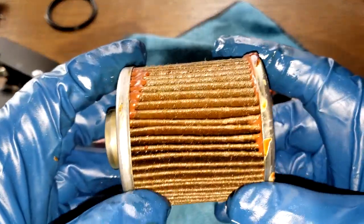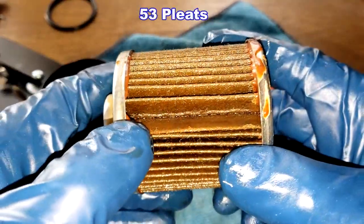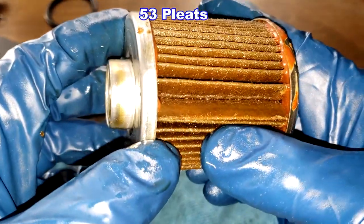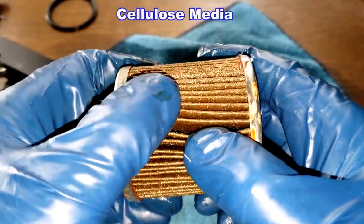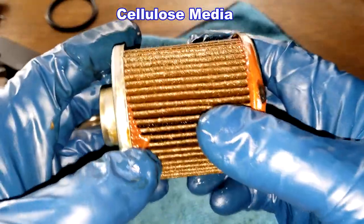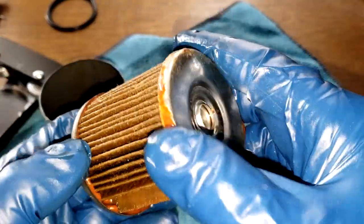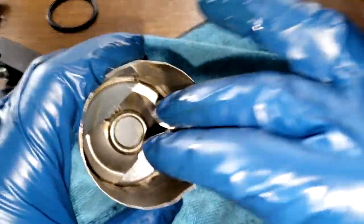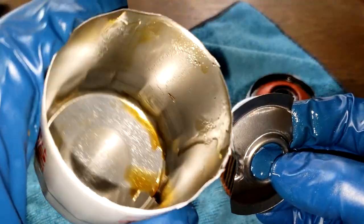Here's the filter element and the bypass valve. There's quite a bit of glue on here. I'll put the number of pleats on the screen. There appears to be a seam right here with kind of a big gap. As far as I know this is a cellulose filter media, but I don't have a micron rating. The pleats aren't bad except for right here — it's pretty bad. And as mentioned, there's some glue on here. You've got your stamped leaf spring and no sludging going on, so the oil looks good.